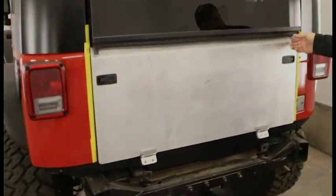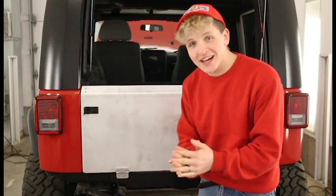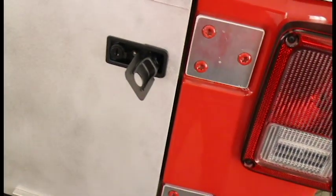It's not drilled in yet, but we got it latched on the vehicle. We got it all the way put together, but right here is a big-ass gap, and an even bigger gap on this side. So after a night of thought, me and Dad decided that this was not the right choice. We're not going to use this tailgate because it's kind of — to be frank — overall it's a good idea, and I've always wanted a dropgate on a new Jeep because there hasn't been dropgates since the CJ. But overall, Poison Spider made that and it's just a slab of metal, and then they have some bracketry that's just really not that well done. And then they use other people's stuff for latches, and the hinges just aren't that sturdy. And to get this open and closed, you have to rub against the rubber right there. It's just all shoddy, and I don't want to put it on my Jeep.